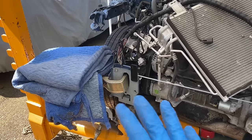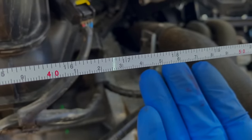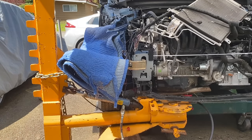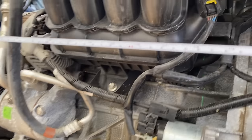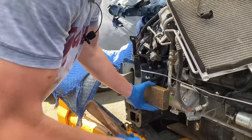We are all set up and ready to pull. Checking where the laser falls — we are right at 426 millimeters, and our target number is 437.5, so we've got to pull it about 11 to 12 millimeters. Right now I have it over-pulled by 7 or 8 millimeters and we're looking right at the 445 millimeter mark. Now relieving some more tension with a hammer.